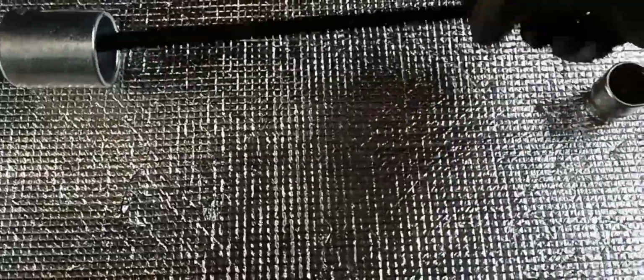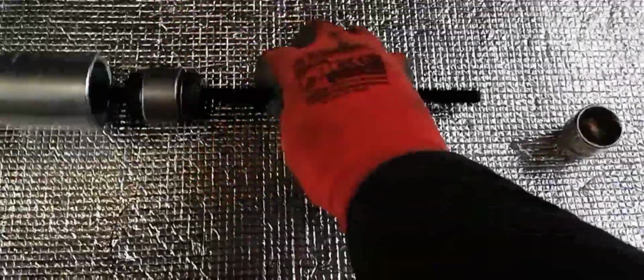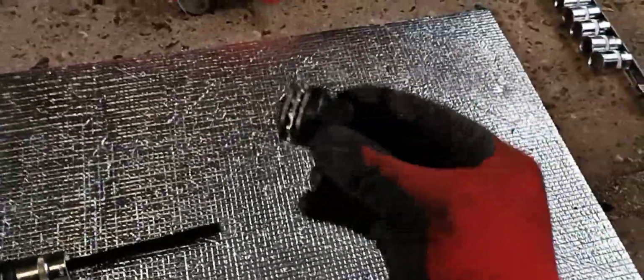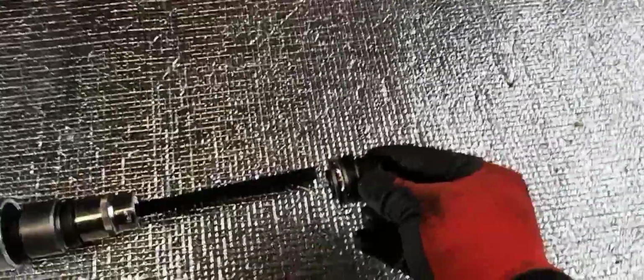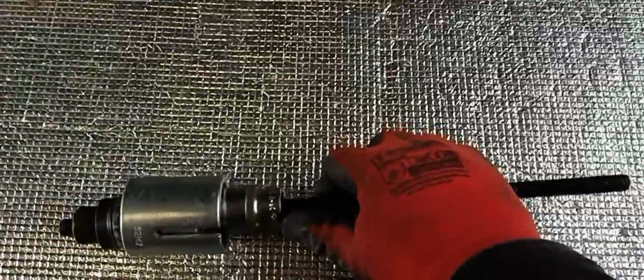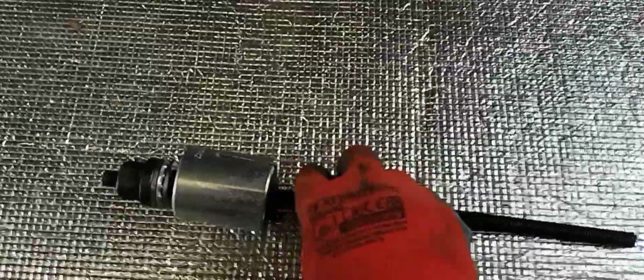And what it's looking to do, so if you imagine my bush is still in place, I put my bush on the threaded bar. And here's my shock coming up from the bush. So the idea is you'd put the socket on the opposite end. That would then marry up to the bush. Then another threaded nut assembly goes on that end, which you wind down. And eventually the socket pushes the bearing through the bottom of the shock and into that. You then wind it back out again. Socket comes away. Then the whole threaded bar assembly, complete with bush, can be extracted.